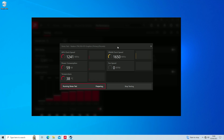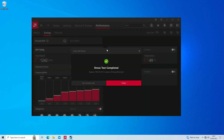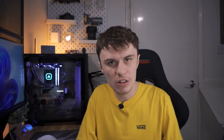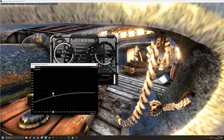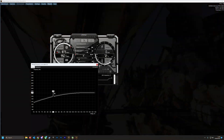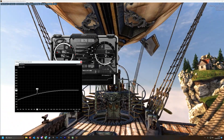This just leads me to believe that the Radeon software is much better than GeForce Experience. The same basic concept applies — you'll know if you've pushed it too far because the test will either crash or glitch out, and if that happens just feed your graphics card a bit more voltage. When undervolting personally, I like to run Unigine Heaven in the background — it's a looping benchmark and you'll quickly see if there are any issues. It's totally free and you can download it from their website, linked in the description below.